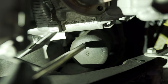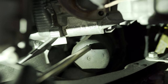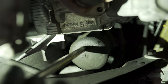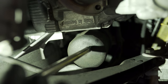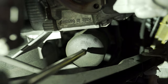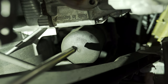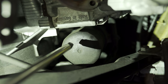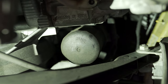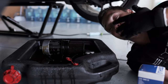I've seen this design before — that's a minus for the Porsche. BMW made it better with the filter on top, not on all of them but still. What the BMW has that the Porsche doesn't is a drain plug in the oil filter cap, so you can drain everything the oil filter holds, put it back, and then remove the cap — it makes it much less messy, especially on the V8 engines. The BMW has the filter at the bottom as well but it's made a bit smarter.